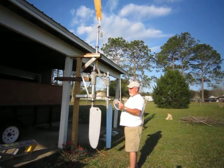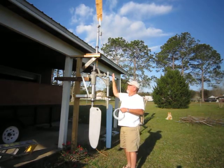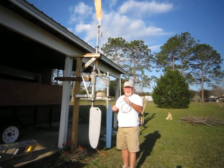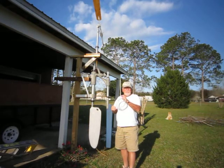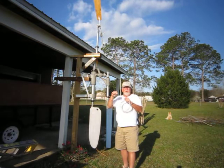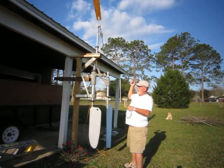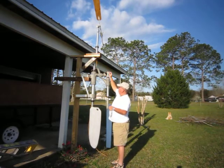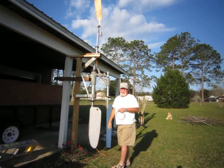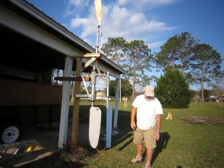This wire, cut in half, gives you two of them that hook up to the wind blade — two wires. It's kind of like a bicycle where you have the outside of the wire jammed into a mechanism and then the interior of the wire is free to move in and out, but it's held by the exterior up there. The wire then comes down and hooks right here — one on here and one here — so you have two wires going up to the blade.